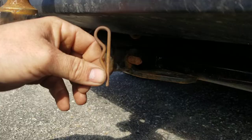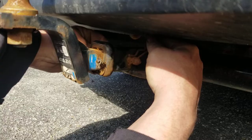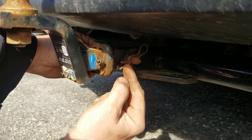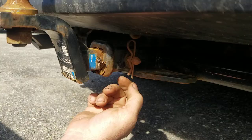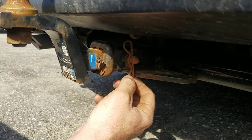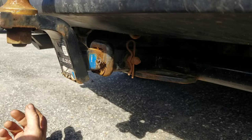When you pull it apart it should have some spring tension to it — that is the proper way to check a clip. With the weight facing down, I rotate it slightly and put the clip in from the back. You should have a little bit of a hard time putting it in — snapped in. Now it's touching here. With the weight facing down the hairpin is held in place; if pushed up it could come out, but the weight holds it down.